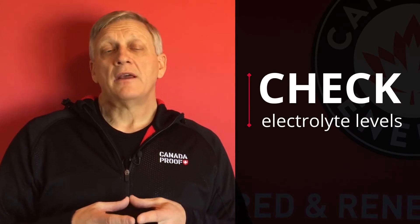We want to check electrolyte levels. It's important that the top of the plates in the battery are covered by about half to three-quarters of an inch of electrolyte. This can be more in bigger batteries such as golf cart or floor scrubber types, but in automotive starting batteries, typically half to three-quarters of an inch over the top of the plate. A common mistake is to open the caps and fill it right up to the top — you don't need to do that. Overfilling is going to cause electrolyte to pump out, creating a mess and corrosion.